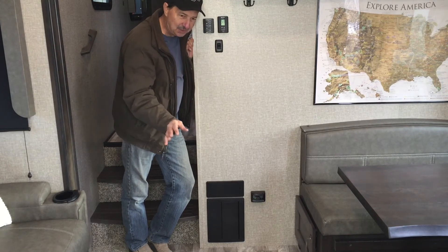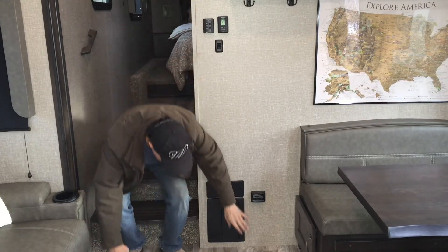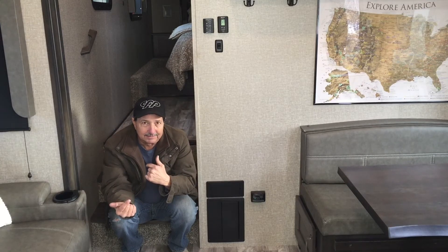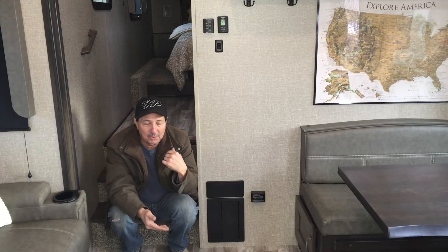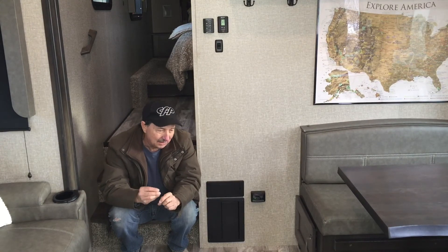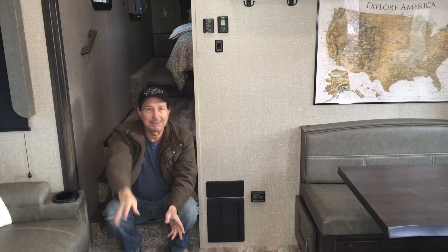Now I'm finding other issues. Now that I've removed the panel where all this stuff is, there's some plumbing and electrical down there. I've got a couple of pipes that are leaking. The previous owner didn't know what they were doing when it came to running the pump — they ran the pump off a valve that was switched so there was no water; it couldn't pull water out of the tank. So it collapsed those pipes — they're flat, they won't suck anything through. I'm hoping now that I've got the vacuum suction relief off of those, maybe I can get in there with a blow dryer or heat gun, heat them up, massage them, and open them back up. But that'll also be in another video.